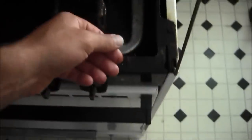To close the stove top, just bring it down. Sometimes the pressure of pushing it down can make the pilot go out. You can sometimes see through the cracks to check — let me look with my eyes. Okay, I can barely see it there — see that little flicker? Then check over here too. I see a little blue flicker right there; it's hard to see but it's back there. Same with the bottom pilot — just reach all the way back and light it.